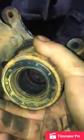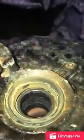You have 2 bearings and 2 seals. One of those seals is different, so you got to make sure you put it in there right. I'll discuss that later. Once you've done all that, I like to save everything, clean everything up, just examine everything, make sure I don't have no cracks in my welds. You know, on my old bike, I had it crack here on me and a little bit further back down the frame.